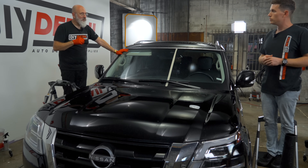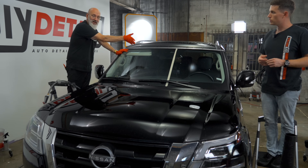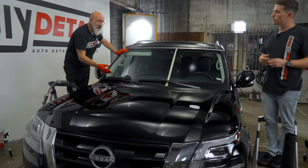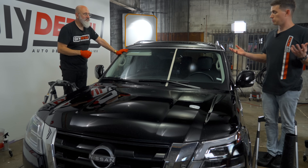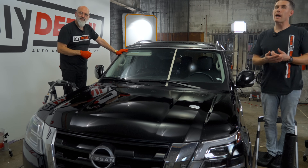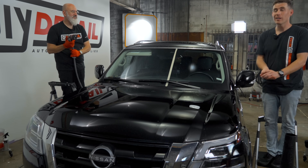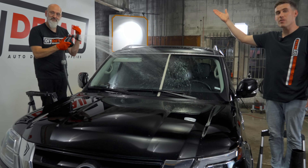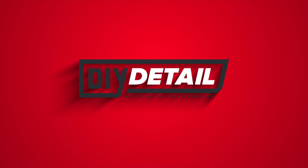To determine which way to bend the arm: if it goes smoothly up but chatters down, the wiper is twisted toward the glass on the downstroke — twist the arm down. If it chatters going up but is smooth on the way back, twist it the other way. I hope we've blown your mind as it relates to windshield ceramic coatings. If you think this is cool, ceramic coatings on paint are even cooler. Click on the video in the center of your screen to see more beads. We'll see you next time.